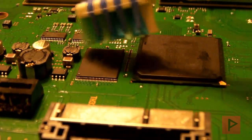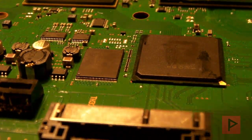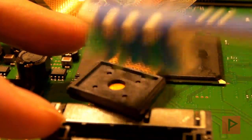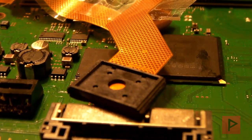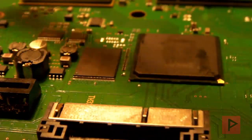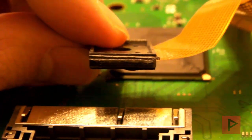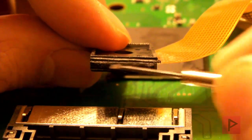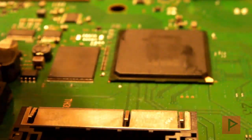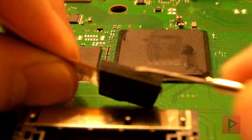With the toothbrush I just scrubbed it on the sides, both sides, and then on the underside of the NOR E3 flasher clip — right-hand side, left-hand side. I'm just simulating that but that's what I did. I also had a very tiny flat-head precision screwdriver and I scraped it on the right-hand side of this clip, then turned it over and scraped that side too — about a couple of millimeters on both sides.